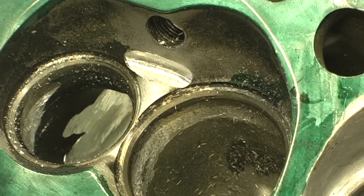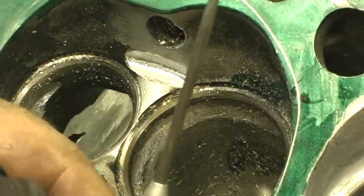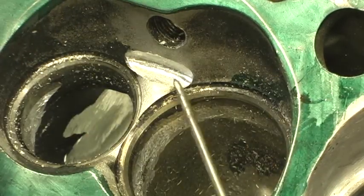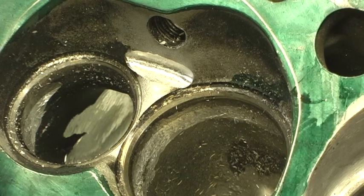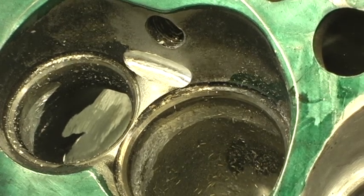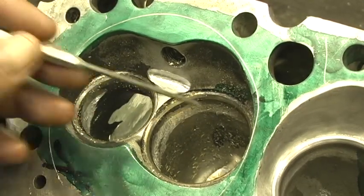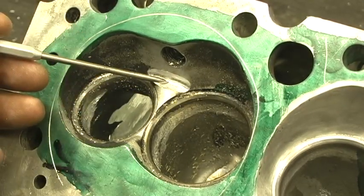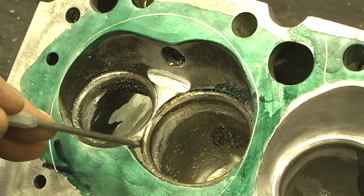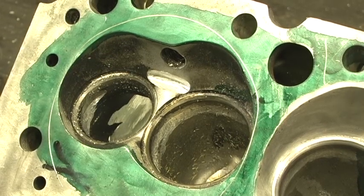That's why the big block Chevrolet head works so well — because the big block Chevrolet head ain't straight. It's angled off to the side, and as it lifts, it goes away from that combustion chamber wall and all this area is clear. So we understand why we're doing it — trying to get away from that wall. We can't go over it, so we cut the wall down like mowing the grass and let our beautiful little stream of air come and roll right on out. We'll cut it in that area too. Let me show you what it looks like in action.